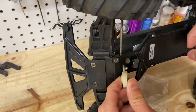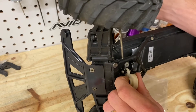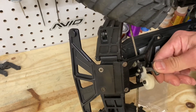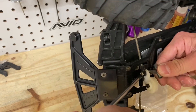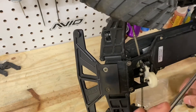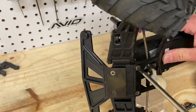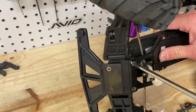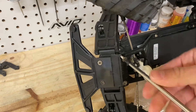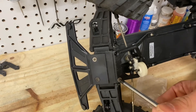You can see the lock nuts right there. On this particular Stampede it's the older version, not the XL5, so you're going to have all standard hardware. It's kind of tough — it's easier if you take this brace off, but I'm lazy. Don't ever run without this brace. I did it one time and paid the price — ended up snapping the chassis in the front.